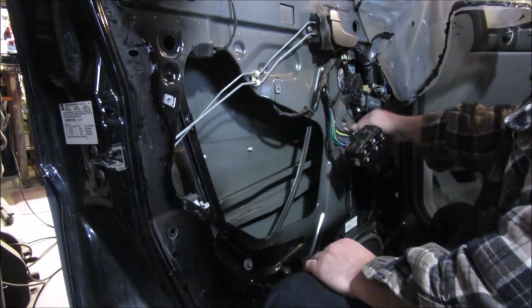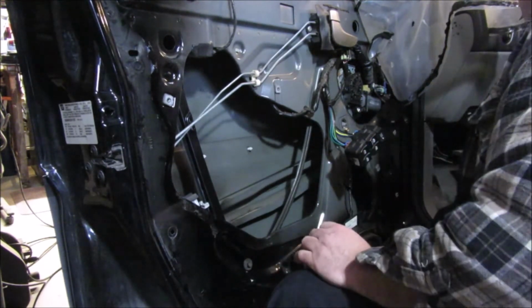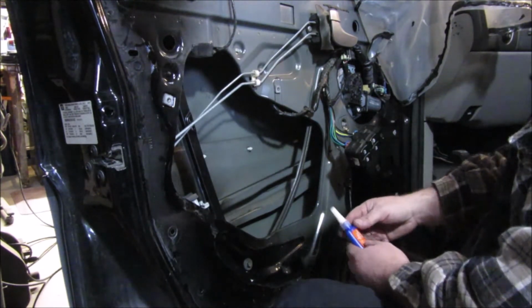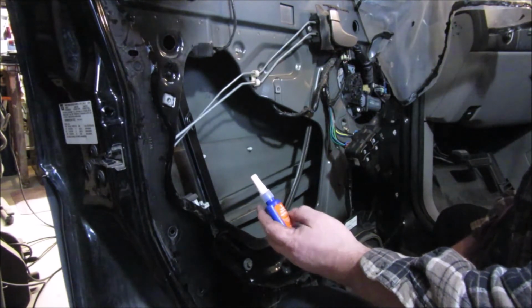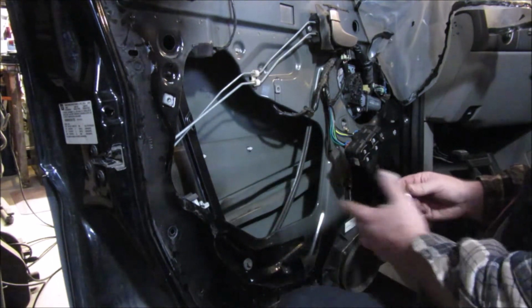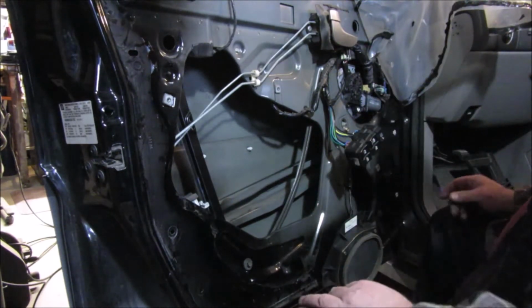I put it on this bolt here first where the motor goes. Then I got these two bottom ones in. I went ahead and used some of this Permatex Loctite stuff. It's a new one I hadn't seen before, but it's kind of cool. It's orange thread locker. It's high strength but removable. So it's supposed to be kind of similar to the blue but be higher strength from kind of what I can get out of it.